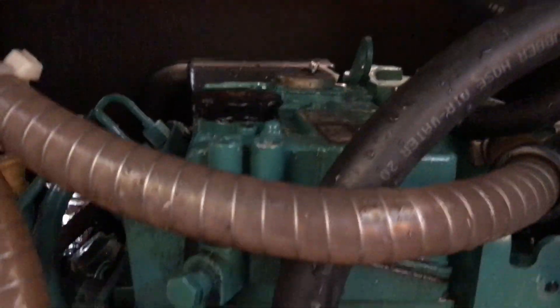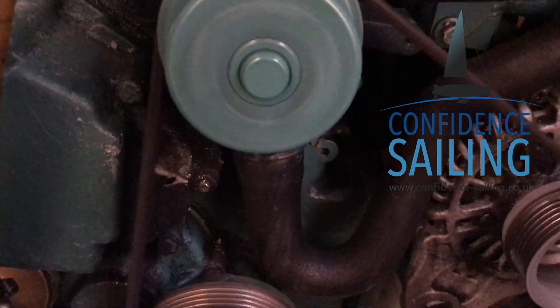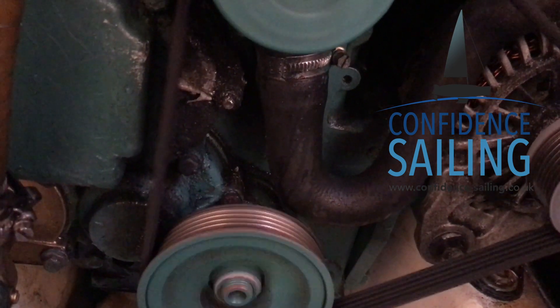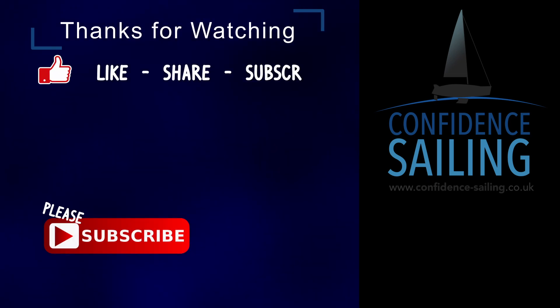When the engine's almost full it does take a while to bubble through to the header tank. But according to the instructions the engine is self-bleeding, so once you know you've got your four litres in the engine you should run it for an hour, checking the level in the header and topping up as required. So that's it — I hope you enjoyed the video, please like and subscribe and thanks for watching.